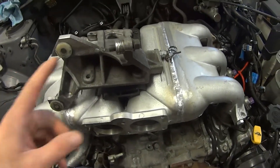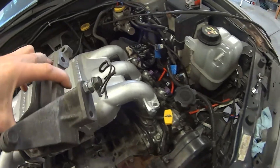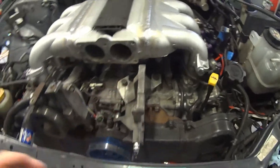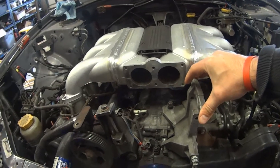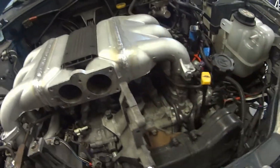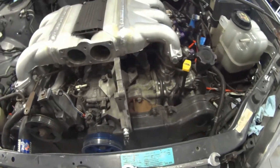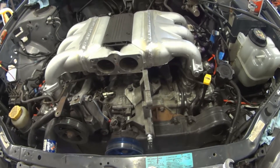This is not going to work out well for me now because the alternator essentially has to move. You can see the alternator would live right between these two brackets, and that's exactly where my charge pipes are going to go, so that will not work. One thing I might do is scour the junkyard to find a smaller alternator and mount it over on the side where the air conditioning was — that's probably what I'm going to do. Those are the things you should think about when rotating your intake for a turbo EJ setup. Hopefully that helps you guys out — like always, take it easy, Easy On Cars.